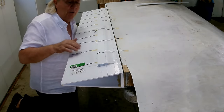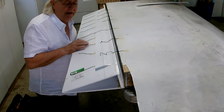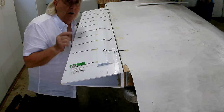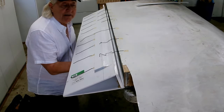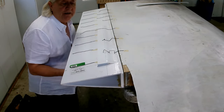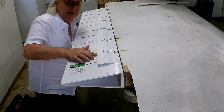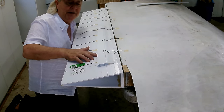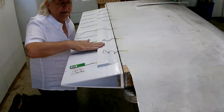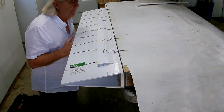On my wing, if you deflect it down, the tufts all just point straight out to the wing tip. We want to keep the flow attached and going aft. So hopefully, every time this gets deflected down, it sucks up some air off the lower surface, shoots it up through the plenum and out the top — there's about a 3/16ths of an inch gap to let the air out — and by turning this corner with the cover, that'll help keep the air attached to the control surface.